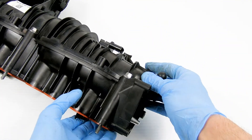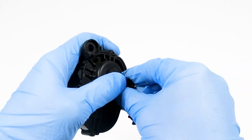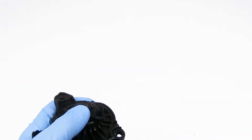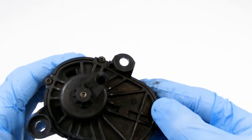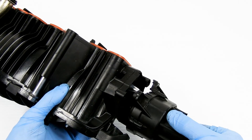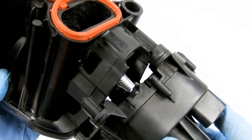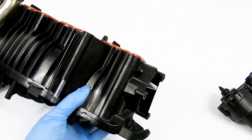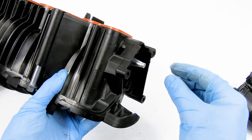On the previously removed motor, disconnect the swirl flap rod rotating arm as this is no longer needed. When refitting the motor, the bung should fit snugly against the motor. If it does not and there is a gap left, as shown here, you will need to fit our spacer. Fit this to the end of the bung that is already installed.